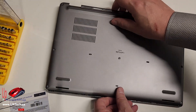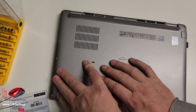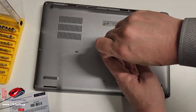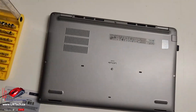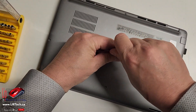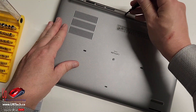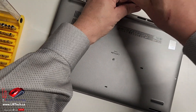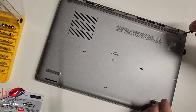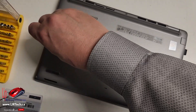And that's it — put the back back on. Pop it down. If you hear some cracking, don't worry about it, that's expected. Pro tip: go torque the screws again after you've done your work, because sometimes you might miss one — it's easy to miss one — or sometimes a screw isn't quite set properly until you put the other screws in, and then things come loose.